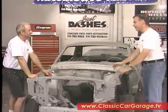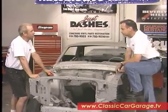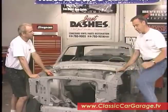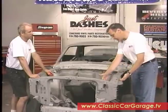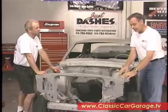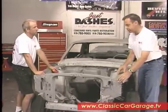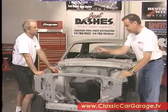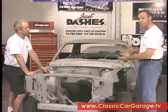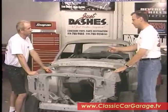You've got a tape measure in your hand — what are you up to today? What we're going to do is take diagonal measurements across the front end of the car just to make sure that everything's square. We were a little suspicious about our project car due to the fact that this inner apron here is a little bit buckled. Sometimes this can be an indication that the car has been hit up here and pushed back, and if this side is shorter, our fenders won't line up and our doors are going to have tight seams. So it's important to know what the measurements are.